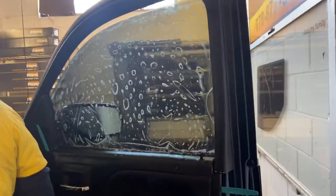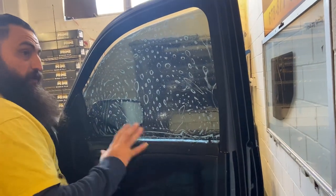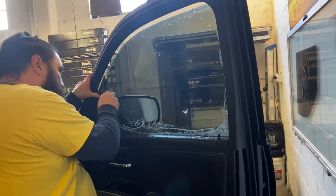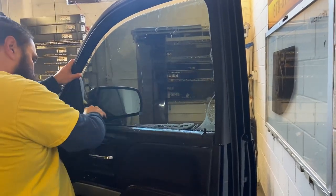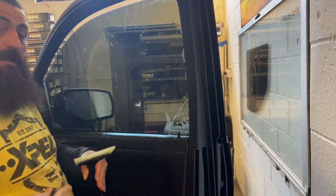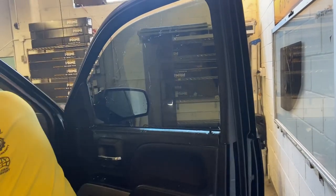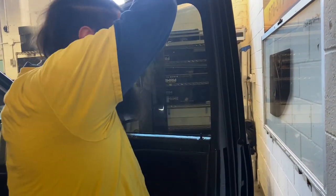Let's get going on this thing. This can be done much faster — the purpose of this video is not to show you how fast it can be done. It's just to show you what I do at any speed. As you get better, you can get faster. So I'm just going to start squeegeeing out. I'm doing really light strokes right now because with bottom loading, there's so much slip. To do it my way, you've got to use a lot of slip. I like to wipe my tools a lot, especially these hard parts — you don't want any grit or sand on them.